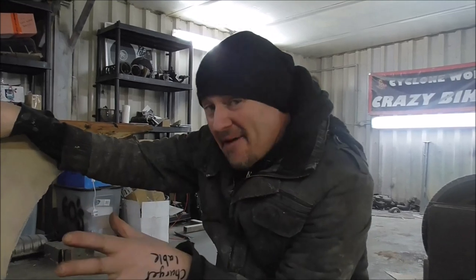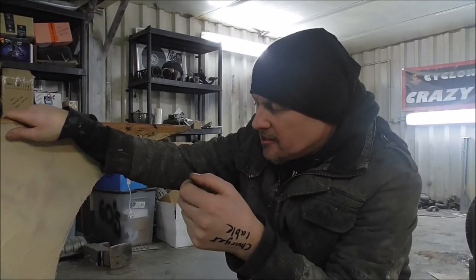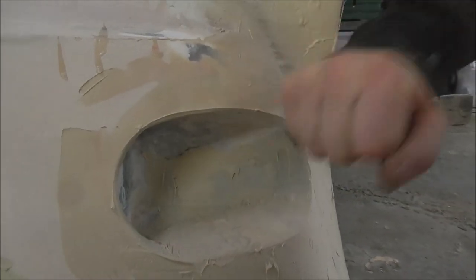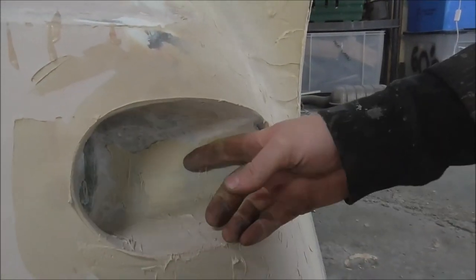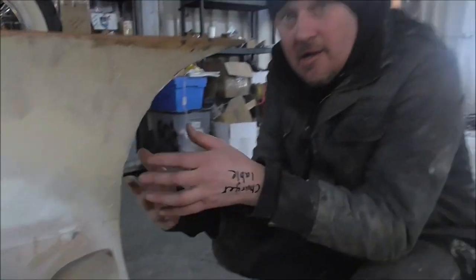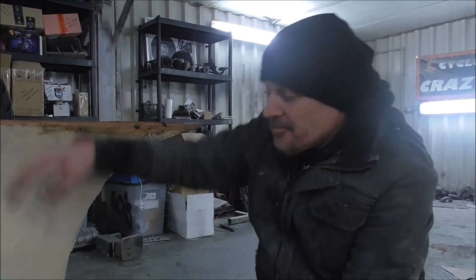So then, after the red fibre paste, and that really did get it all a lot stronger, I've just gone over it in some filler. Obviously this filler is unsanded, but there it is. It's rock solid, it will be glass from the back, so all those pieces are made one. I'll glass actually inside the fender, and that will make that a lot stronger and a lot better.